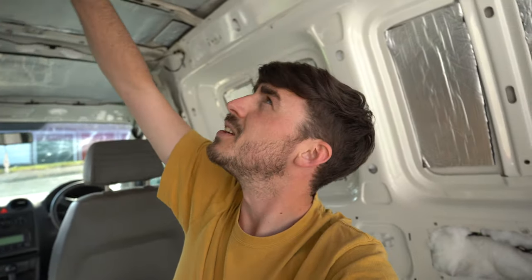So a little bit of research, obviously, I was doing before the build. They were saying about the insulation is you don't want to stuff it too tightly packed, just because it defeats the purpose of insulation. So all the holes that we filled up on the roof and stuff, we've still made it fluffy, so it's still got the purpose of what I've fitted it for, really. So just in case anyone says that we've tightly packed it and it's pointless, we haven't. We've made it so that it's still an air gap, let's say, to do its thing.